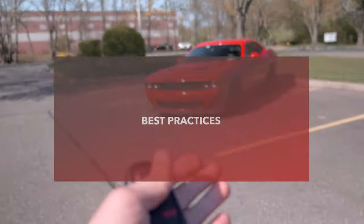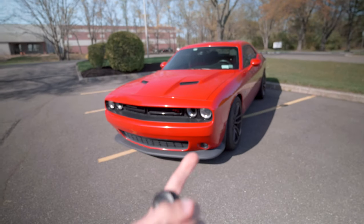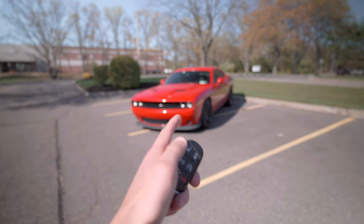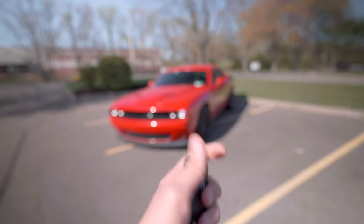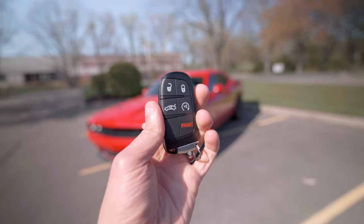One of the reasons we love this feature is because it really does help protect against theft. The majority of the time thieves are cloning your key signal, programming key fobs, and using relay attacks to take over a vehicle's computer system. They enter your vehicle through the car door proximity sensor and then use the push start. With kill by fob they're not duplicating the same key ID, which we verify via the car's VIN number. To clone the lock and unlock key ID they would need to physically press the buttons next to their cloning device. Even if a thief finds their way into your vehicle through a window or sunroof, they won't be able to unlock the gas pedal because it can only be unlocked through your pin or the key that you locked it with. A good habit to get into is to always lock your vehicle using your key fob. When you get back, unlock it with that key fob and the vehicle will be unbricked. If you forgot and unlock it using proximity entry, you can just use your pin lock key code, but locking and unlocking with your key fob is the recommended habit.